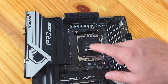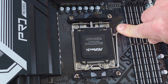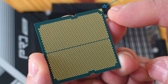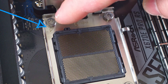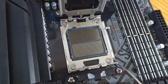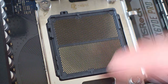We're going to start by installing the AMD Ryzen 7700 processor into the socket. To open it, push down on the arm, pull it out, raise it, slide it back, and raise the lid. On the CPU there's a gold triangle, and there's also a triangle on the top left corner of the socket — we're going to match those up. Make sure you don't touch any of the pins; if you touch the pins you could damage the board, making it almost impossible to repair.